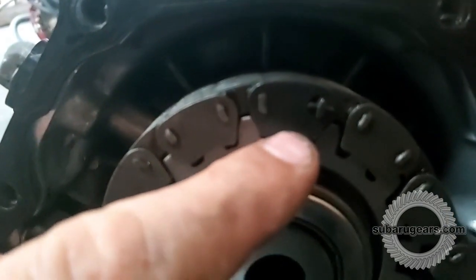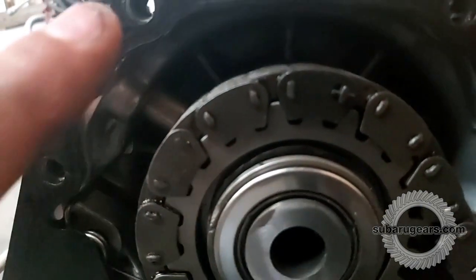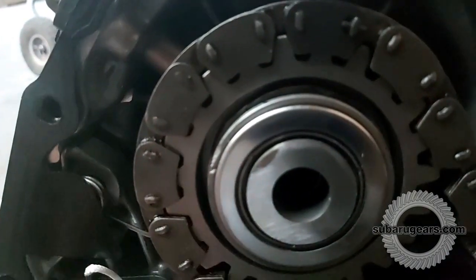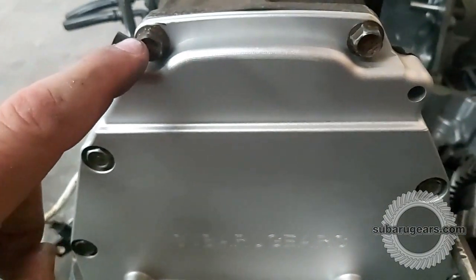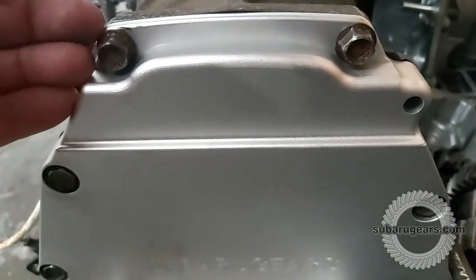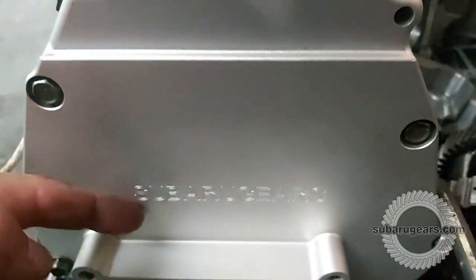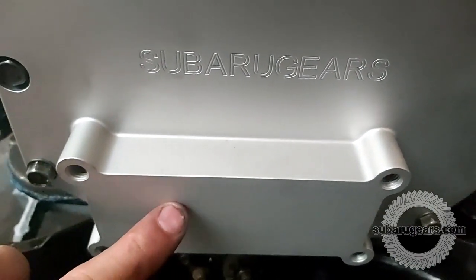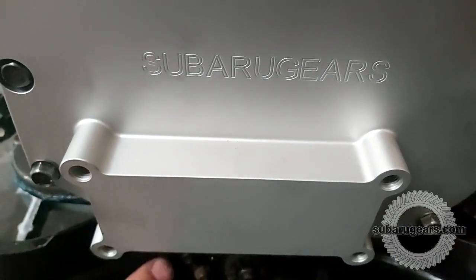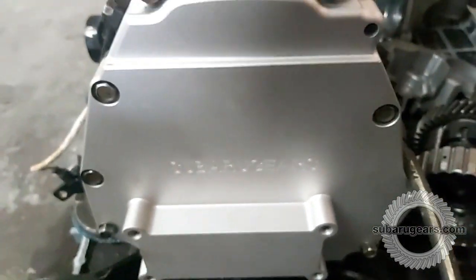I've assembled the chain with its looped end on and the through pin, and made sure the thrust bearing is back in position. It's time to put some gasket glue on the gasket and put the rear cover on. The rear cover is on now using the original short bolts and long bolts. We've given this as much thinness and clearance as we can to get the trans close to the firewall. The recessed bolts are in the upper part, and it has an integrated mount platform that should bolt to the Volkswagen Vanagon original transmission mount.